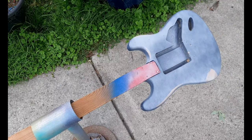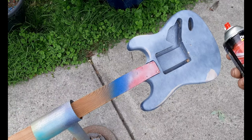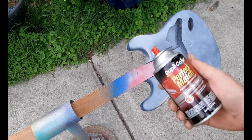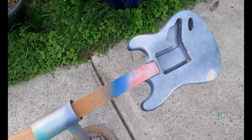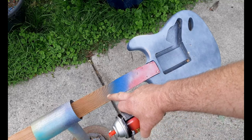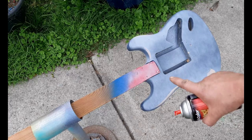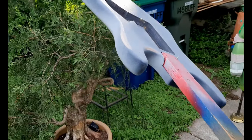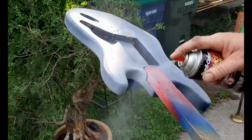What you see there is what I always start with - I call it a dusting. It's basically just like as if something were dusty. This is scratch filler primer. I'll let that dry for about five minutes and then come back and do the rest. I'll pick this up out of the stand and move it around to be able to get inside the curves. For the primer I just do a few light coats, just enough to get full coverage.